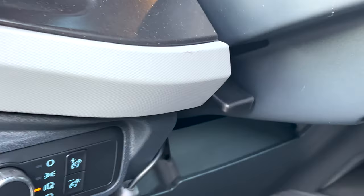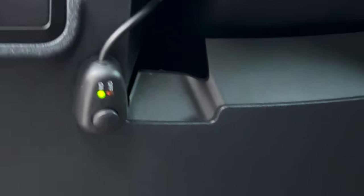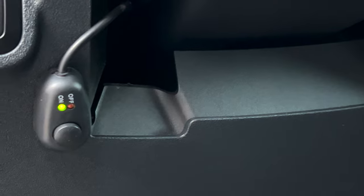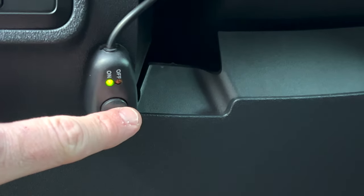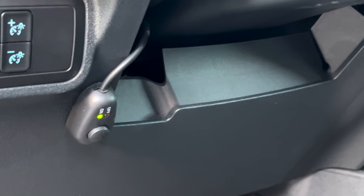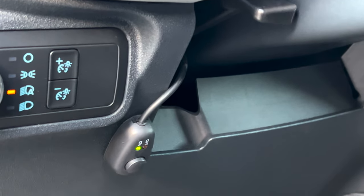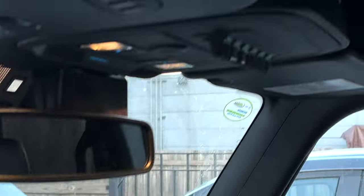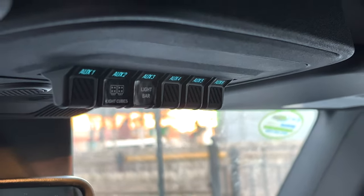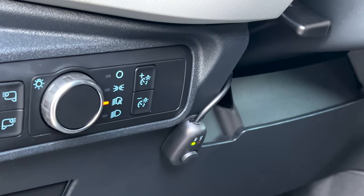I ran the cord up under the grommet — you can't really see it here — all the way to right here below the steering wheel, next to the headlight assembly. The way I hooked it in, it only turns on when the ignition's on, but I wanted the option of turning it off and on with a switch in a discreet area. That way if I'm out camping or in an area where I don't want those on with the ignition on, I can turn them off. Some people may just wire it to be on with the ignition regardless, or wire it through the auxiliary switches — but do what's best for your needs and you'll be fine.